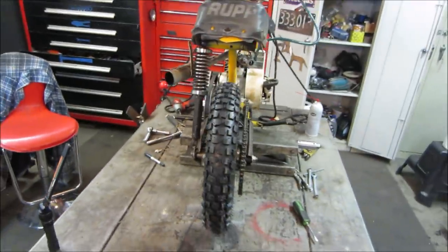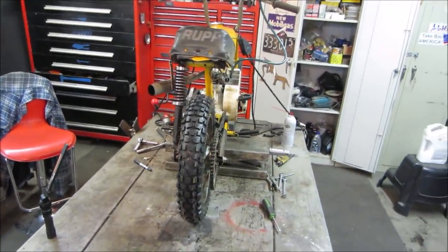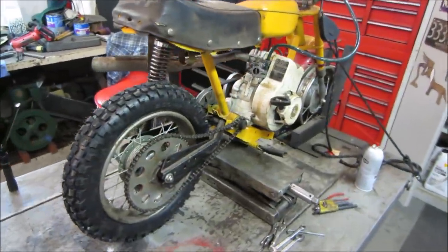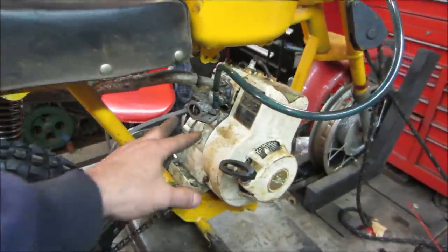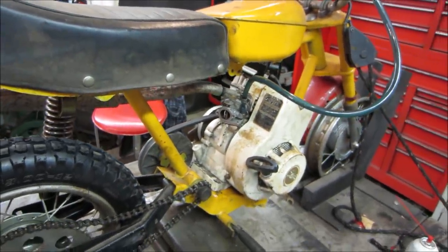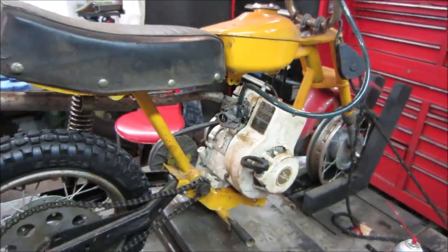Maybe the other carburetor sounds like it ran a little bit better. Probably going to go swap that one out. I think that might be our better bet. I could dial it in. It's close. We still don't have an air cleaner on it, too, so you have to kind of dial it in with that also. But I'm going to go swap over the other one more time. We'll pick the best of the two.